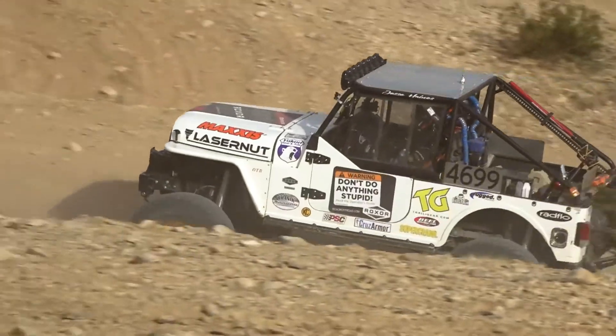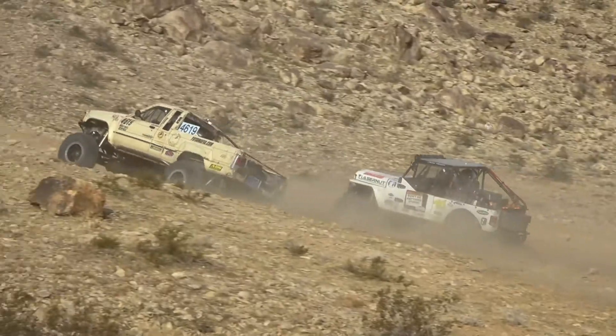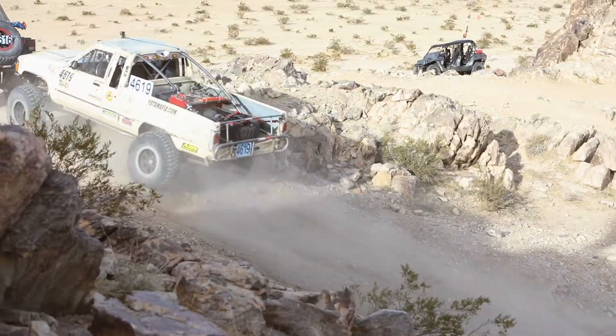It has Hellfire knuckles on the outside for steering up front, and a ported ram assist box. The rear axle is — believe it or not — a stock 80 series Land Cruiser full-float housing that I've done some Rusty Nail Racing stuff to. We built a homemade truss that turned out really good, and it has 300M rear axle shafts, 4.88 gears, ARB, drilled and slotted rotors.